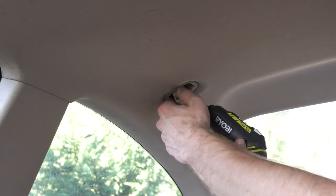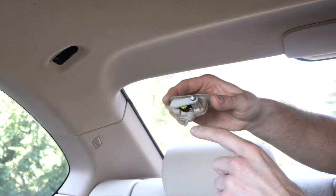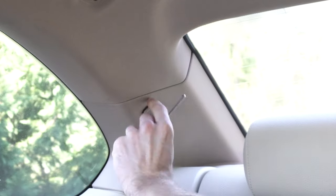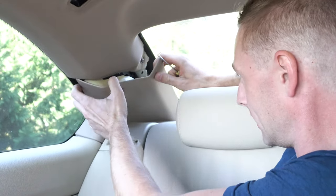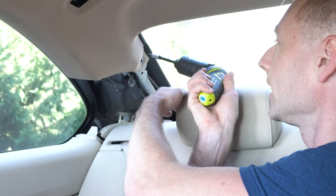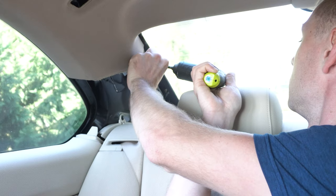Cloth hanger. Press to open, undo the screw, pull it with the angle toward the front of the car. You want to be pretty careful with that because it has a fragile mechanism inside. C-pillar, same as the A-pillar but with tougher pins. To remove it safely, you need to undo the pins from the rear window, otherwise that's gonna happen. Then undo the last T20 from the liner, which is located very at the back.